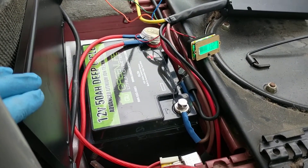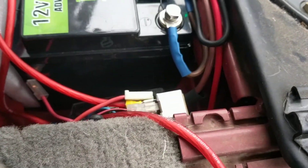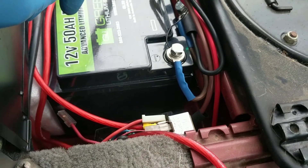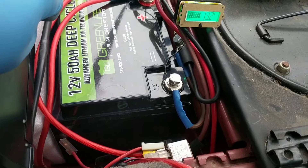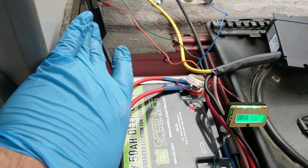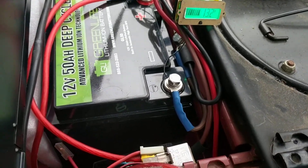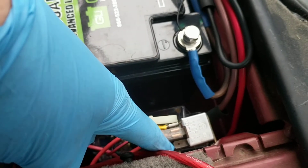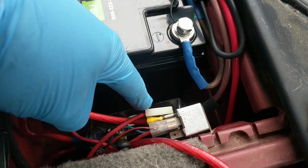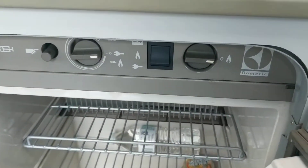I had this idea to basically just hook the 12-volt Dometic refrigerator's 12-volt hookup to the battery and see what happens. Before people get all panicked, there is a fuse over there. What's happening here is we have our 12-volt power coming over, and I've unplugged the 12-volt refrigerator power which was on this relay — it's actually this wire right here. Now we're feeding our 12-volt refrigerator. You can tell because this light is on, and we've got it set to battery mode.